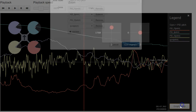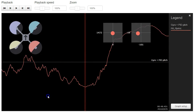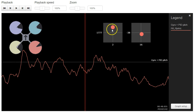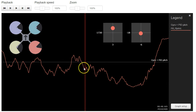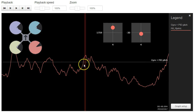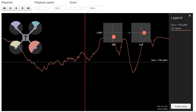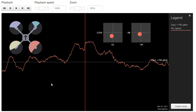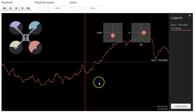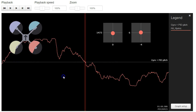Looking at your P term traces, it really feels like you have more room to raise that up. Even at max throttle, we start to see the barest signs of some surging, but we don't see any actual up, down, up, down, up, down oscillations across the axis. We just don't see any of them. I use the analogy of squealing tires on a race car. If somebody's out on a racetrack driving around and you don't hear the tire squeal one time, they're not going fast enough.